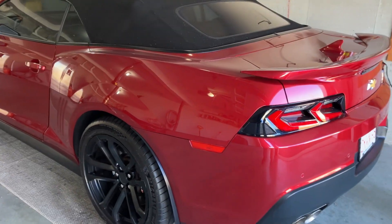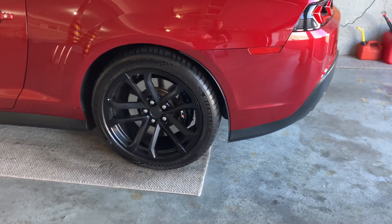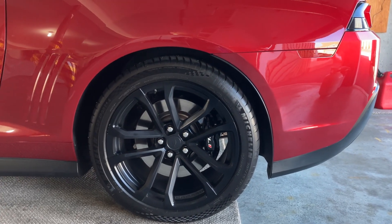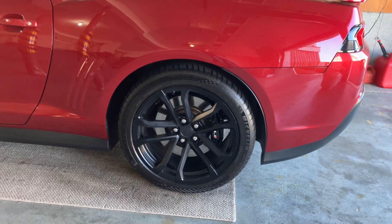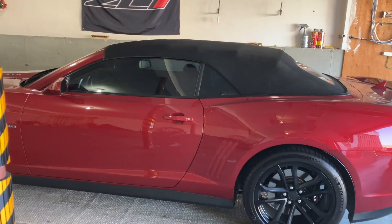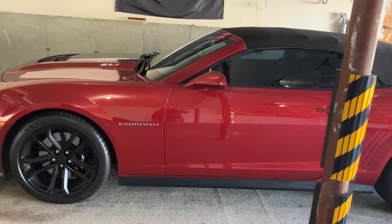Next, I like to put something between the tires and the concrete. Parking for three or four months probably won't hurt the tires, but I like to park on a rug. I also like to keep them at the recommended tire pressure. I've seen others over-inflate their tires to prevent flat spots, but modern tires won't form flat spots unless subjected to sub-zero temperatures, and over-inflating can possibly cause damage to the tires.